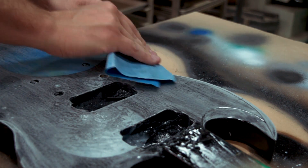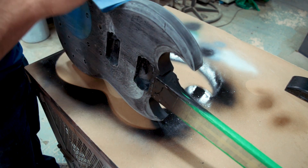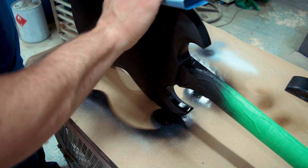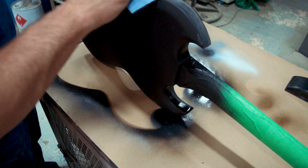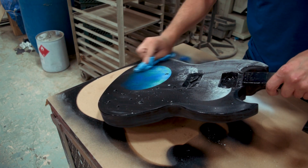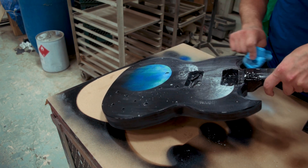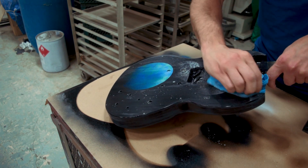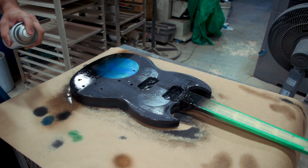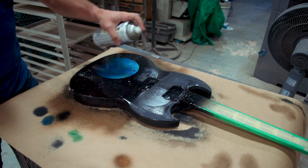You guys will get a better look at how flat this ends up in my next video. For this one I put on one coat of semi-gloss, and you can see it gets really close. I'll probably come in and do one more coat to make sure I've got a nice flat surface without any orange peel left over. The only imperfections in the final finish will be whatever crops up in that very last coat of semi-gloss. As always, once you're done sanding, before you spray, clean everything off with wax and grease remover. I'm spraying just the one can of semi-gloss this time, in the opposite direction from before.